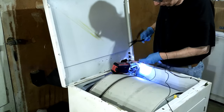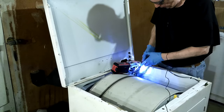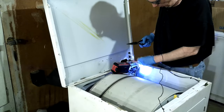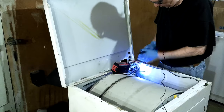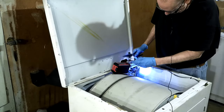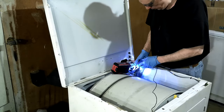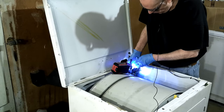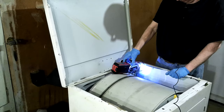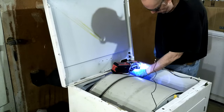Get that on there so it won't rub the drum, then turn it on again and see if it heats. I think I want to run it around these wires here to keep it from rubbing on the drum. This is just a jumper — I'm leaving the original wires on there because the timer wouldn't communicate without them. They're thermal switches, so when they get to a certain temperature, if they're working right, this one will just let go — it's a high limit switch, basically the emergency switch to shut it down before it burns itself up.